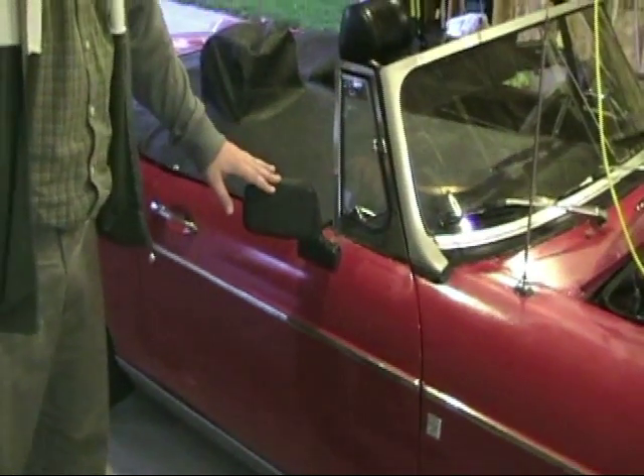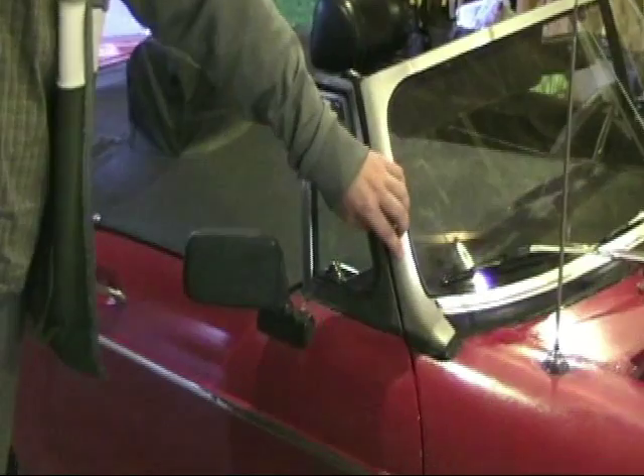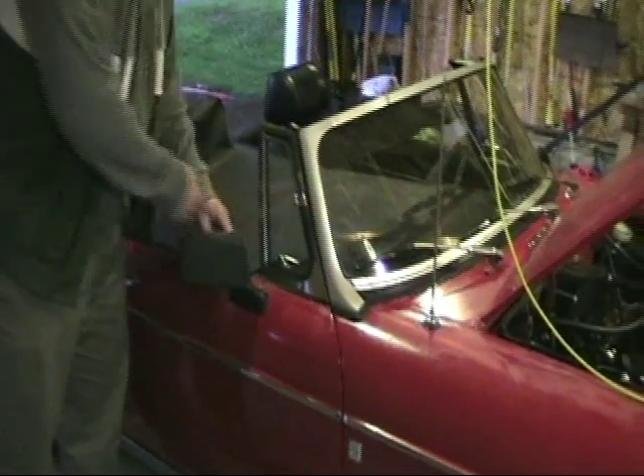I'm not really a big fan of these mirrors — they're aftermarket. I think the original ones are chrome. The previous owner mounted them way too far back, so I had to look through the corner of the metal to see anything, which means I basically can't. So I moved them forward. And this right here — this is what is referred to as the crack of doom. It's one of the most well-known manufacturing defects of the MGB. If you go look at a used one, it most likely has cracks right here on both sides of the doors.